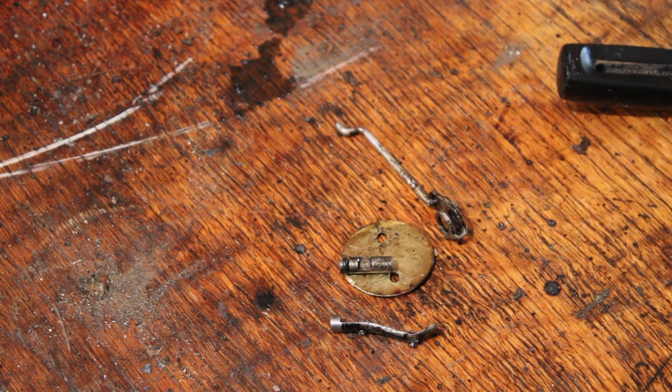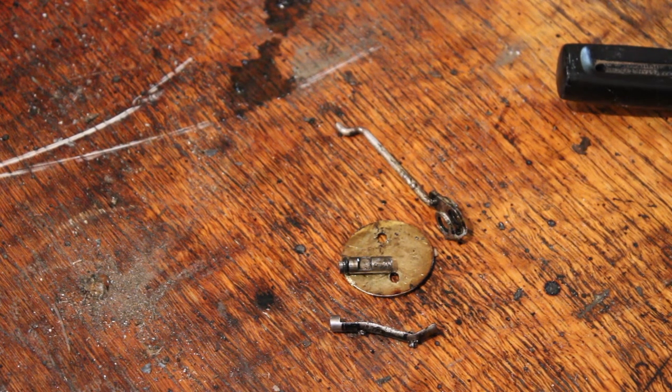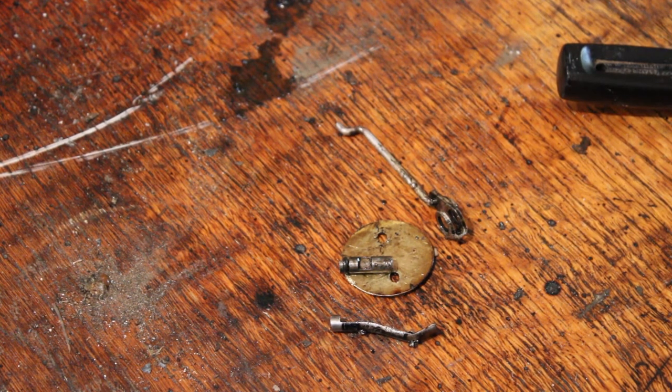Now I've got to clean out all the chips and debris from me poking around in there with a screwdriver — I kind of scratched some parts of the case, so I want to get that cleaned up as good as possible so it doesn't get sucked into the engine. Also, we've got to get some sort of plug into that hole on the outside of the case, and it's not threaded. I thought it was going to be based off what I was reading on the internet, so we might as well just run a tap into it and then thread a bolt in there and call it done.